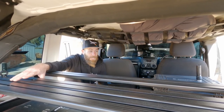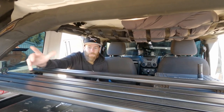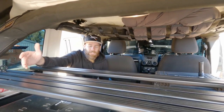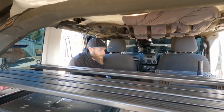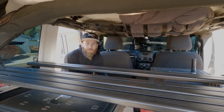So I forked out that extra money — bloody expensive. But there are a lot of perks. Over time, it's really probably about the same cost as an AGM. You draw it down a lot lower, charges quicker, longer life expectancy as well. So a lot of good positives with it — it's just that initial cost that can be deterring some people. Well, there's the Patrol and the Jeep — very, very basic when you break it down.